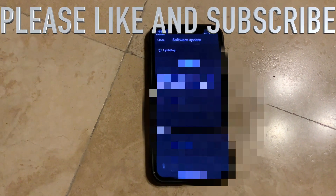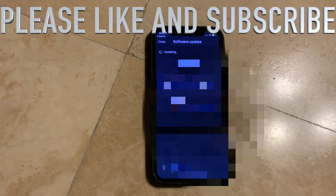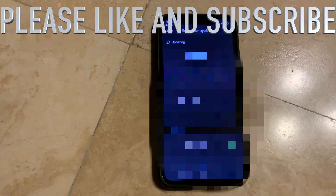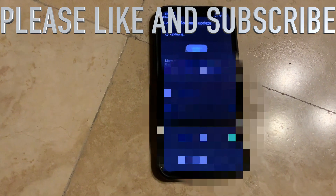I was having a lot of issues. Philips recommended unpowering the Hue bridge and then powering it back on and waiting 30 minutes — I tried all that and nothing worked. I was stuck on the same screen, and all I did was start tapping that button and it started doing the update. Just follow that technique and hopefully it'll help you guys out.